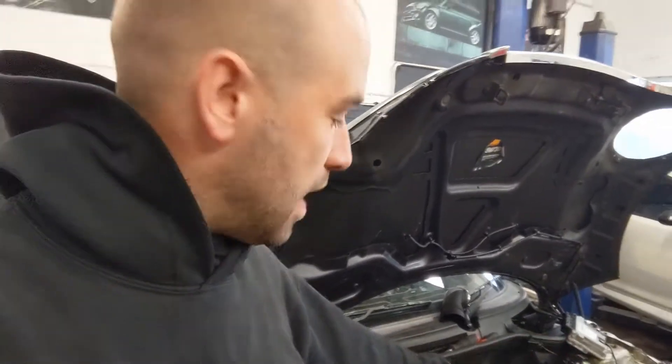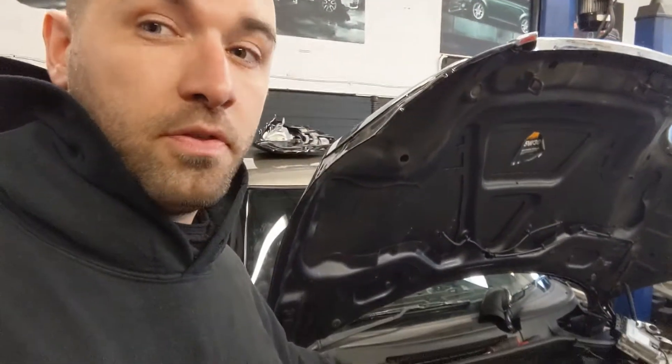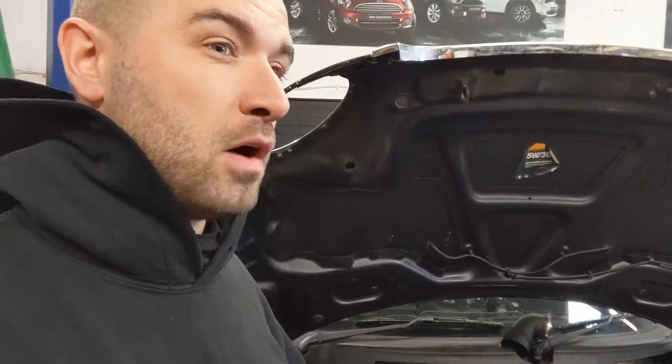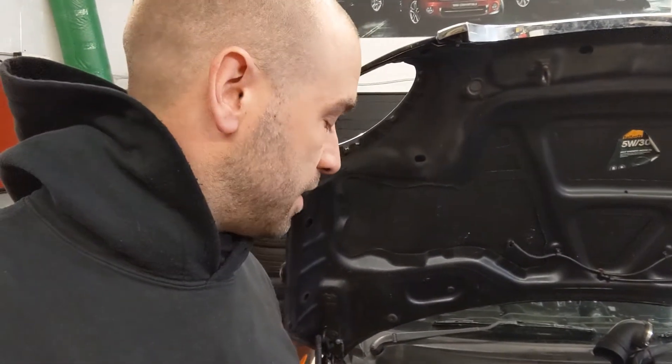What I've done: I traced the wiring back to the ECU — checked out fine. Each of the coils had a 12-volt supply. Engine earth and chassis earths are all good. Checked the crank sensor for supply voltage — it had 5 volts and 4 volts down each wire, and then the third wire was either an earth or a signal wire.